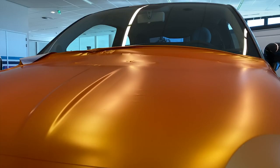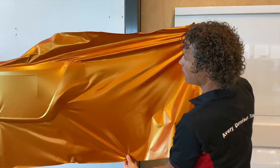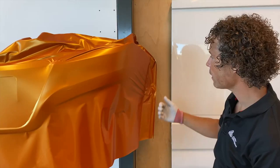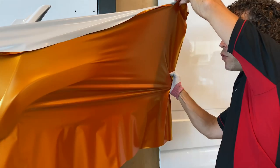Bumpers and mirrors have more complex and extra extreme shapes which lead to more tension. How you divide the tension is very important. Pay attention when you start positioning the film. If you choose the most straightforward method, in many cases you might create tension somewhere else. Watch — if I just simply pull it around like this, it eventually results in an excessive amount of film here that will be difficult to process. What you need to do is divide the material. So how you position the film is very important. Pay attention to where you position your hands. The film has the right temperature and now I'm going to position it. I position my hand here in the middle and you see the crease appear. Now you can easily divide and spread the film to both sides. You see that on both sides for now I only have a little bit of tension.